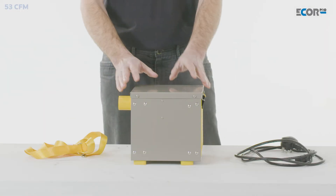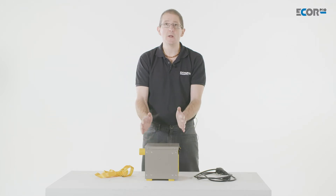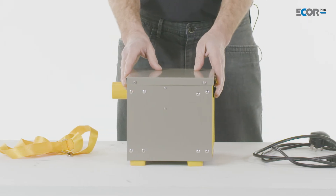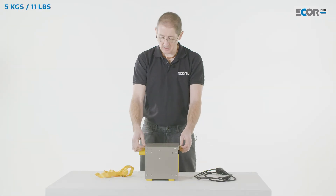It's a low-capacity machine. It moves about 90 cubic metres of air an hour, which is quite a high volume, and it only uses 370 watts, so very efficient on energy. It's very light — it weighs only about 5 kilos.